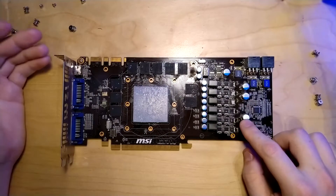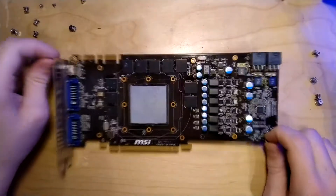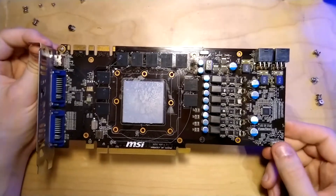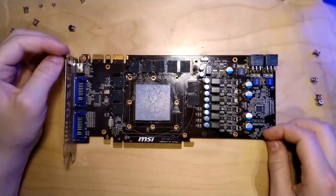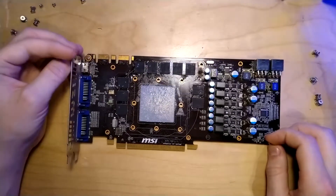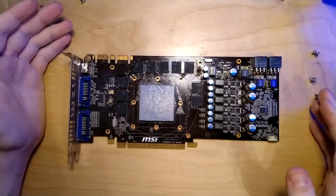I'm not going to make a full breakdown because I don't know which MOSFETs these are, so I obviously don't know the RDS-on rating the low sides have, how much current they can withstand. There's going to be a video that will clarify this - because now I'm getting to what plans I have, or should I say we have, with this graphics card, because it's actually not for me.